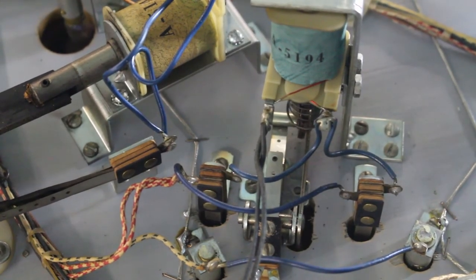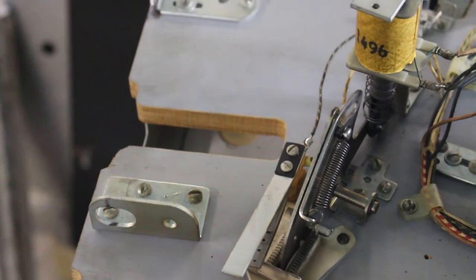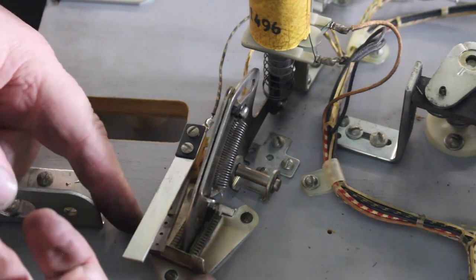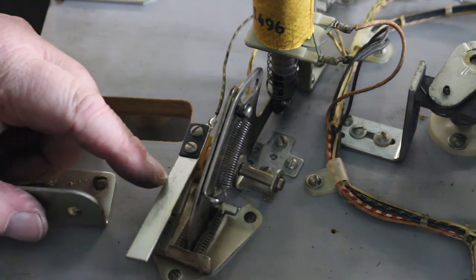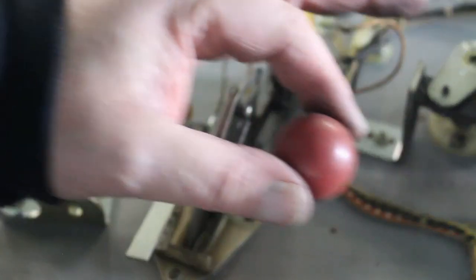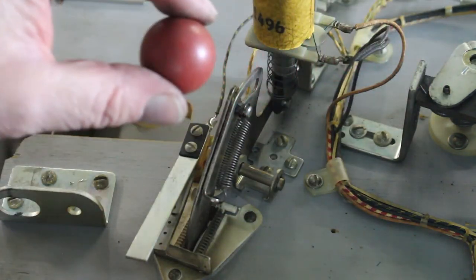The one at the bottom that sends your ball back to the shooter is right over there. I'll come around. This one. Oops, yep, kick you at the same time. This one. The ball drops down. Turns the switch on. And if it has things to do, which it does, this one will collect your bonus. Like on soccer, you have the little balls in the back, in the head unit, that when you run over a target or drop in that hole, it shoots this ball up and it rolls down and it's sitting there waiting to be counted.